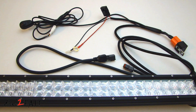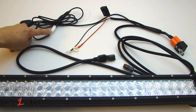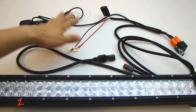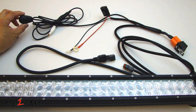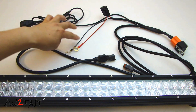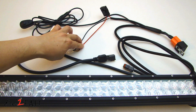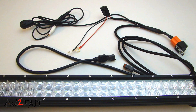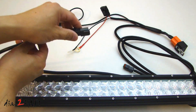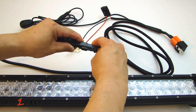To connect the light bar to the wiring harness, it's very straightforward. Over here, we have the on-off switch, which you need to install inside the vehicle. The switch has a connector, which you can disconnect from the wiring harness. After you run this wire into your vehicle, from inside your vehicle, you can connect up this switch to this connector. Over here, we have the negative and positive cable. You connect these two directly to your car battery, and it's fused. Over there on the right, that's the relay. This is the connector from the light bar, which connects to the output of the relay. It's keyed, so it only goes in one way.